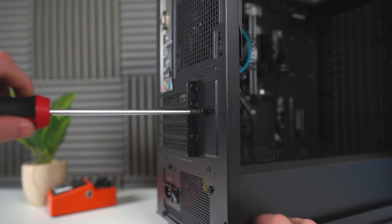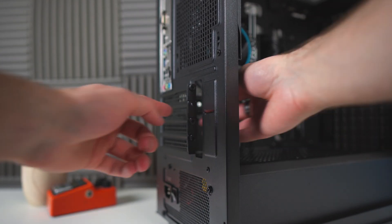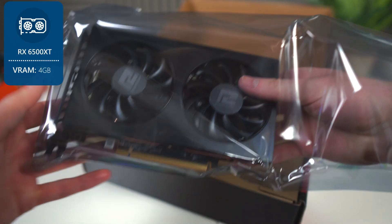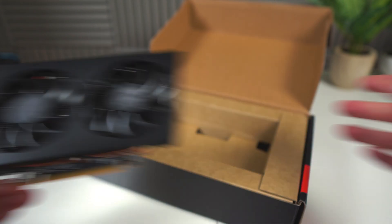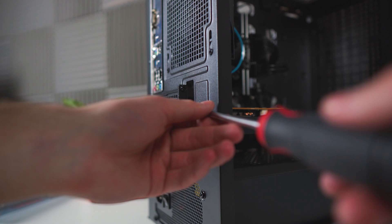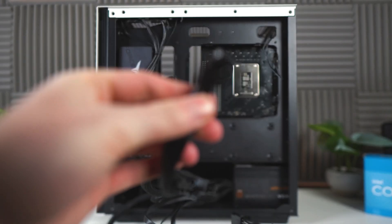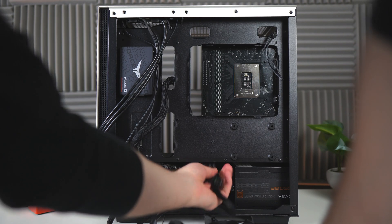Now we're going to prepare the case for the graphics card — loosen up the screw, then remove the two screws and brackets. The graphics card for this build is the PowerColor RX 6500 XT. This card gets a lot of slack, but people often forget it's made for budget gamers who prefer to buy a brand new card instead of buying used. Put it into its PCIe slot and make sure the retention bracket clicks into place. Then, while supporting the card with the other hand, screw it into place, reinstall the bracket, and plug in the PCIe power cable through the bottom middle cutout into the graphics card.